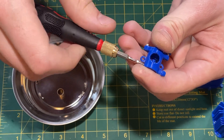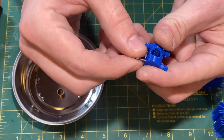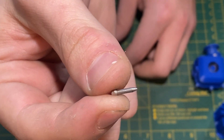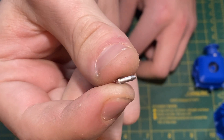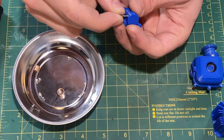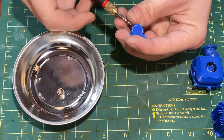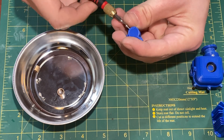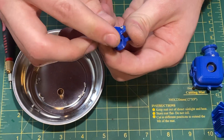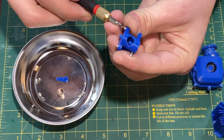The fuel adjustment needle is basically the same 1/64th screw as the other screws, just a little longer. I threw it in my drill — my makeshift lathe — and took a file to it to make a point. It basically acts as a little needle to vary the amount of fuel flow. I also need to be able to control the flow of air, which would be the role of this handle, but unfortunately the handle design wasn't great, so it doesn't really work. That's something I need to redesign.